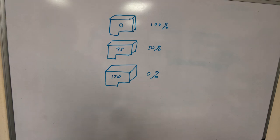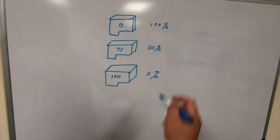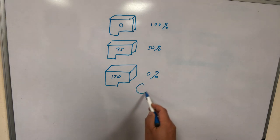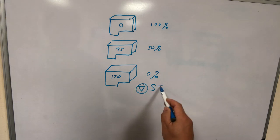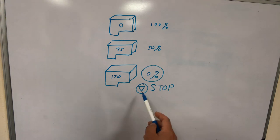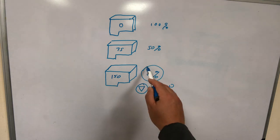However, this function can only be available after you print the maximum amount of pages — you just need to keep printing until one day you'll be able to turn the monitor off. I often get questions: 'I refilled my cartridge but the ink level is still low.' That's because it's a one-way street. Or people ask, 'I did what you said but I cannot turn the ink monitor off.' That's because your ink level didn't reach zero percent. You have to run it all the way down to zero, then press and hold the stop button on the printer to turn the monitor off. You cannot reset the cartridge — what you can do is turn off the ink tracking.